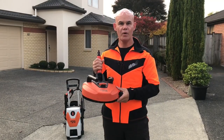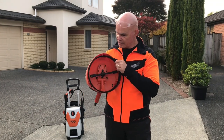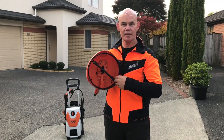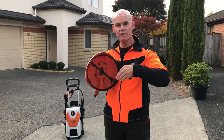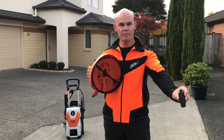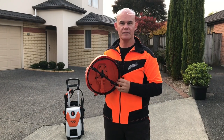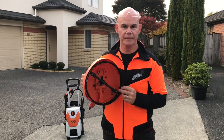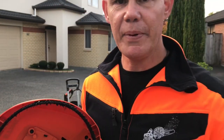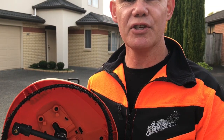So a couple of questions you might have: why is a patio cleaner more efficient than a single jet nozzle? If we take a look underneath, we see two brass nozzles fixed on a high pressure feeder bar. As they spin around they get good coverage and they're not always in one spot — they're moving around over that surface giving us a good consistent clean. Whereas if we have a single jet nozzle, we're guiding that by our eyesight — it's not so consistent and therefore we get little patches. This is why the cleaning is so efficient and so consistent.